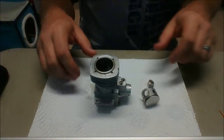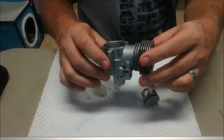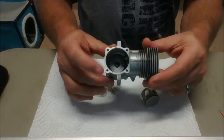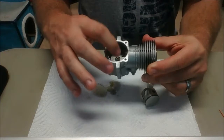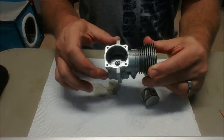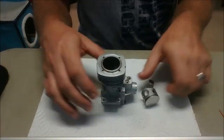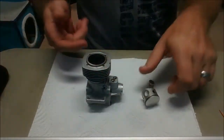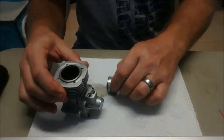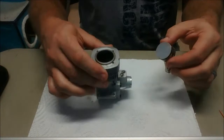What I'm going to do now is install the piston in the crankcase. I previously put the timing wheel back in and I've got quite a bit of oil in there just to make sure these parts stay nice and lubricated — you can see it's coming out here. Some of this oil that has dropped out, I'm just going to roll this piston in it and get a little bit of lubrication on that.